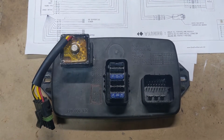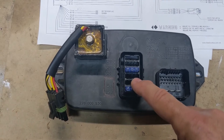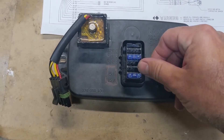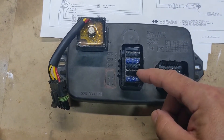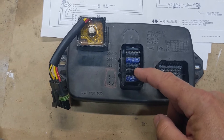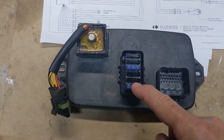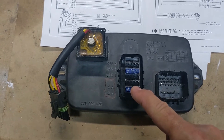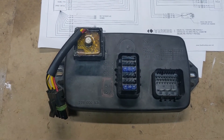Time to do a little bit of surgery on our MPEM. Above this is a five amp fuse that goes into the second slot from the bottom, and when those blow — every time you try to start the ski — that's an indication that the diode inside the MPEM is fried and is creating a direct short.